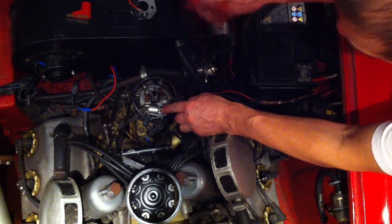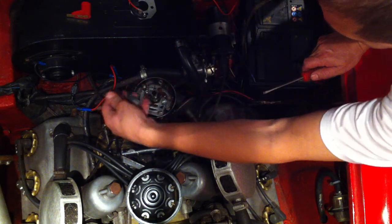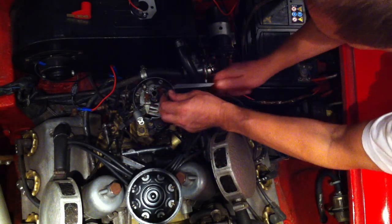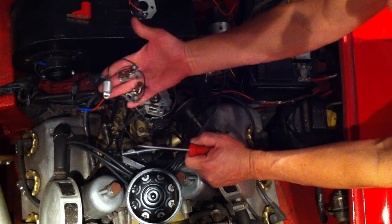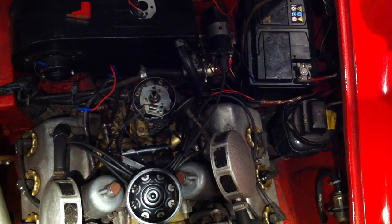There was a little screw hole in the condenser, but I've already removed it. Pull this little black connector out first of all, and then we need to remove the two sets of points. Put a screwdriver underneath them to lift them up and remove them like that. If you ever want to put them back in again, you've got them and you just slide them back in — really, really easy.